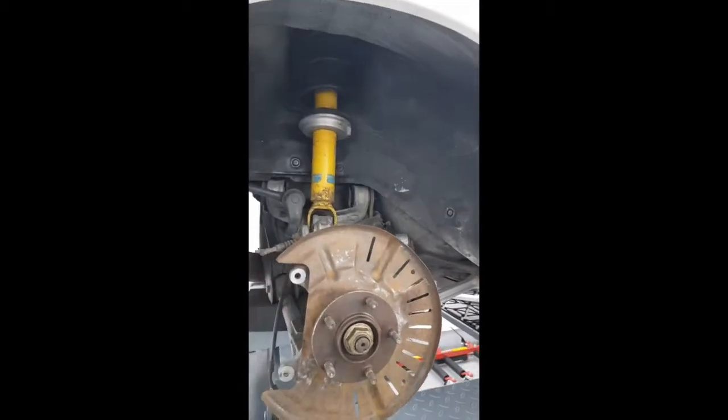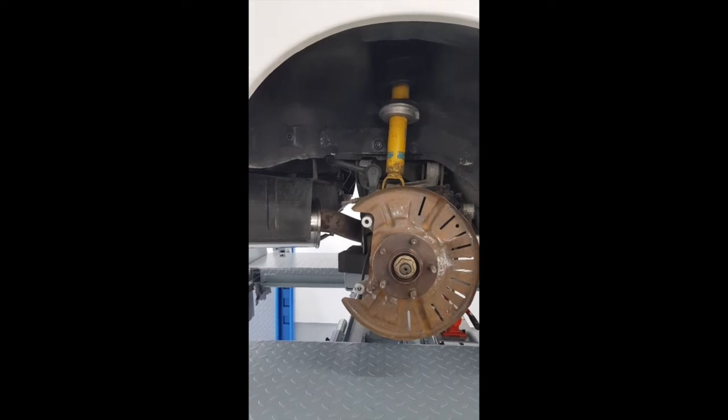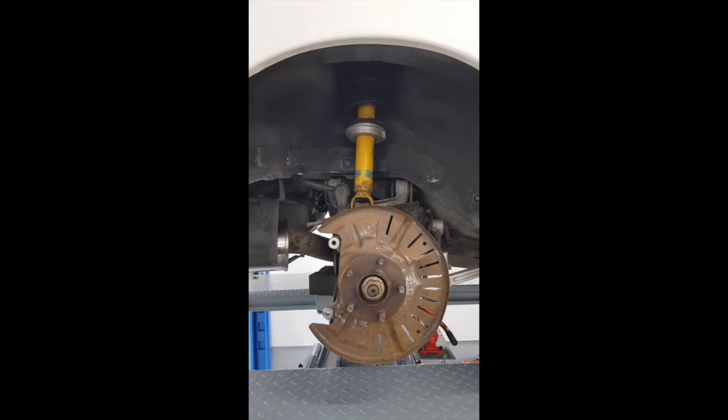This is the rear right — you can see it's covered with what looks like anti-gravel black paint, which I think is overspray from repairs done in the past, probably before the car came back into the UK. I'm thinking I'll mask off everything under here and give this another coat of anti-gravel paint — the surface is fine so I'm not worried about locking in rust or moisture. I got the old exhaust polished up a bit down there too. Up in the corners especially, the other side was absolutely horrific for gravel — I probably had about half a kilo packed in each side, really tucked up in the back of the bumper. If you're looking at your car, really dig that bit out with a hoover and a screwdriver, because it was moist gravel, holding moisture.